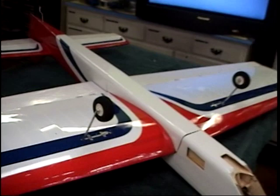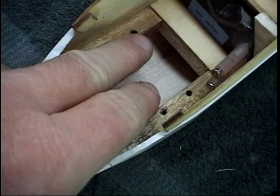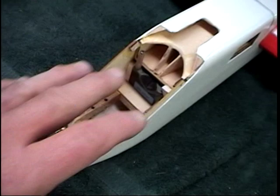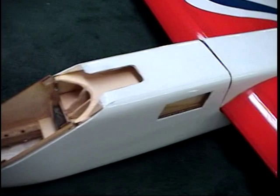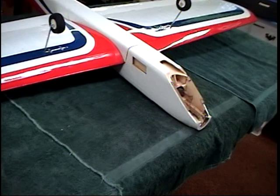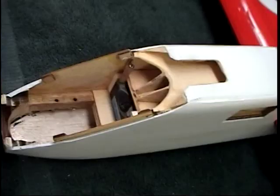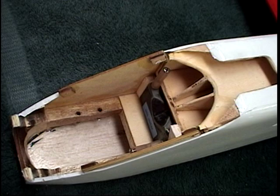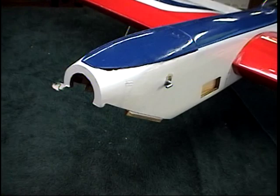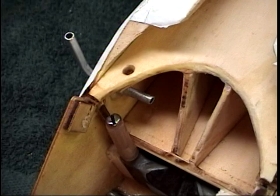Before installing this little top cowl cover, I hollowed some of this out just in case we want to fit bigger motors in there in the future — possibly that 90 is one of the choices. We need to lay out tank venting. Looking around, there are a lot of little details left, but all of them are five- to ten-minute things. I'd like to have one overflow vent and I need to lay out where I'm going to put a uniflow vent — relative to where the motor is and where the tank is going to be. Each installation will be just a little bit different. The uniflow should always be on the inside of the circle, facing forward, so we need to bend up a piece of copper tubing. Now we can install the engine and tank and tubing. Uniflow vent in there, overflow vent, overflow, uniflow — nice and solid.